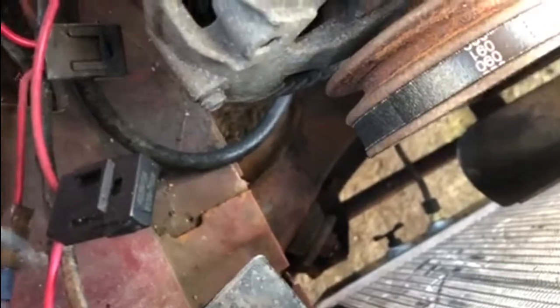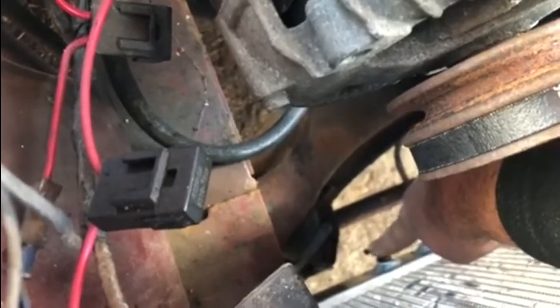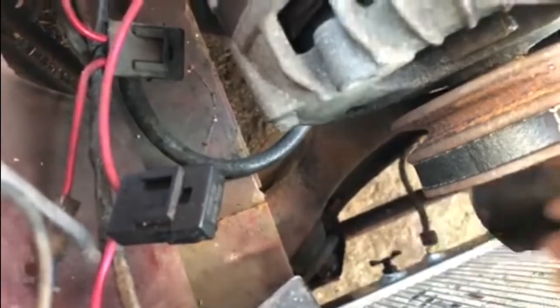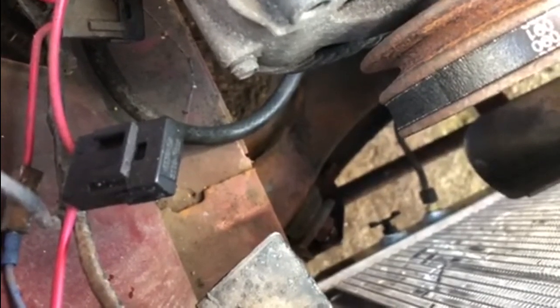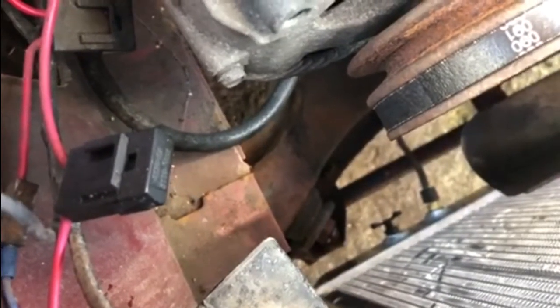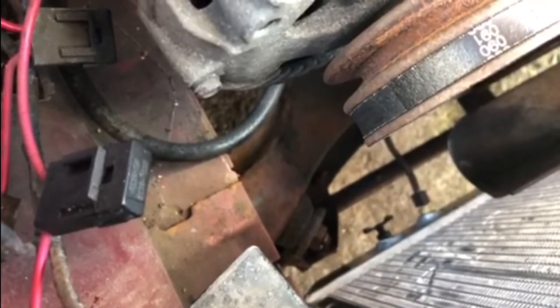Which it did perfectly. That tap-shape item just there — that's the drain plug from the original radiator. Now the thread was exactly the same size; it bolted directly into this one. We took it, bolted it in, made sure it went in fully, took it back out, covered it in Teflon tape, and put it back in again. Filled the radiator with water, fired the car up, let it run for a couple of minutes, then rushed indoors and went to get changed to head off to the wedding. After getting changed, I came out and had another quick check under the car — everything was dry, didn't seem to have any leaks. So we jumped in the car, fired it up, went down to the wedding, and checked it continuously throughout the day. It was as dry as a bone, so that's that leak fixed.